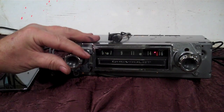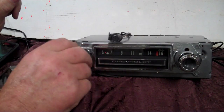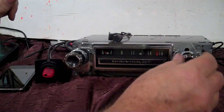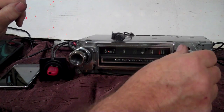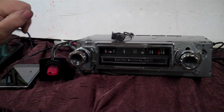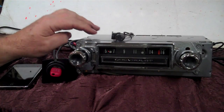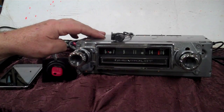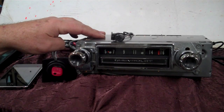Now we'll do the USB. You'll get a thumb drive with music on it and it'll go straight to it. If you want to change songs just turn your tuning knob, or you can repeat by backing up. If you want to charge something, just pull the drive out — it will charge your phone. If you want to go back to radio without pulling it out, just take your volume knob and turn it down twice — that puts it in pause and it goes right back to radio. Turn it up twice to bring it right back to where you left off.